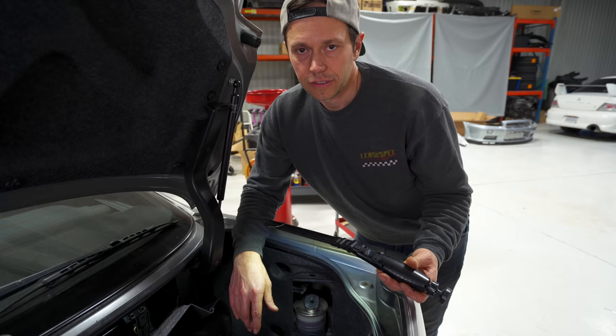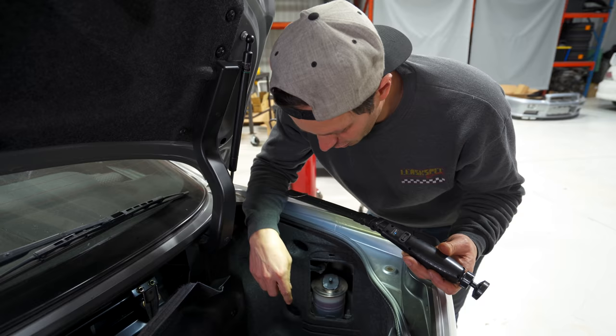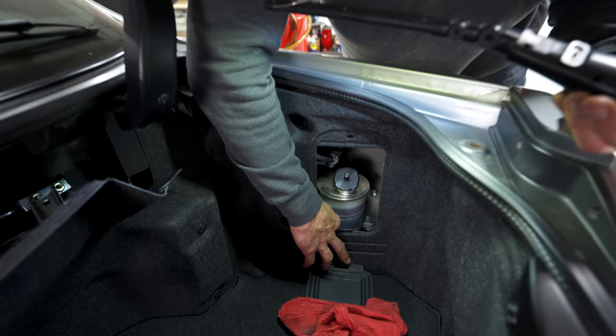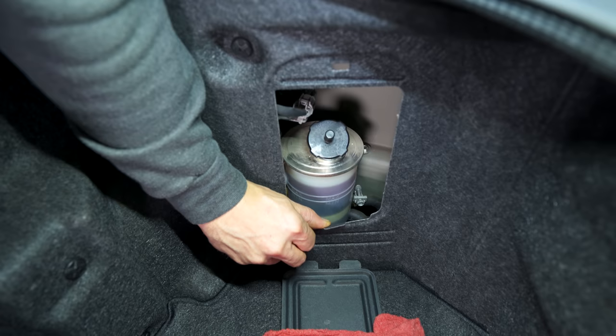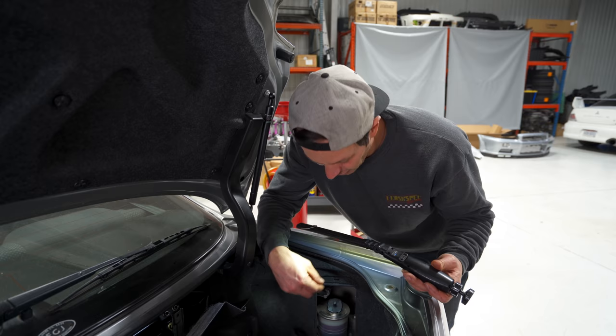So the final procedure on this bleed is to have that connector and unplug it and plug it in, and out, in and out, in and out, until you get the air pocket that's in here down to 5 mil. And as you can see, we did get ours down a bit, but it's just not getting to that 5 mil. We've been giving her like 30 minutes here trying to get that thing to move. So at this point, we're just gonna leave it, come back to it. If you guys have any suggestions, or maybe it's supposed to stay at that. I don't know if that's like an R34 manual that I'm reading. That 5 mil gap, maybe it's different on the 34. So if you guys have any suggestions, certainly post in the comments.